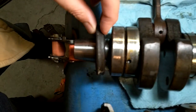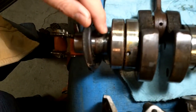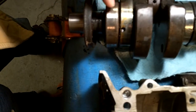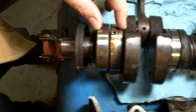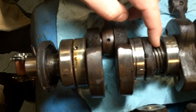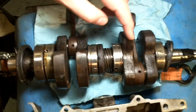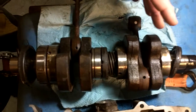We can see the PTO seal was bad — the spring is down in here, it came off, and there's a big gap. This looks to be maybe two bearings right here. There's a bearing here and a seal, and the gear drive for the oil pump. Another bearing, and then here's the other seal — they're obviously both bad.